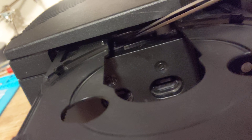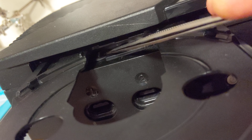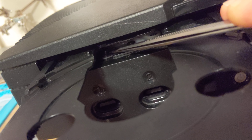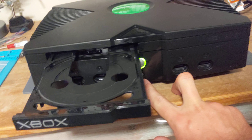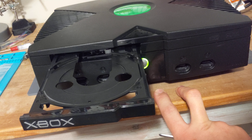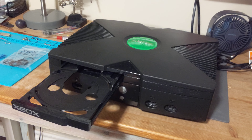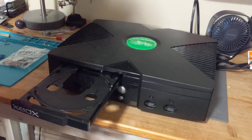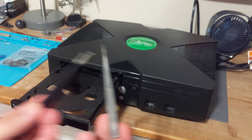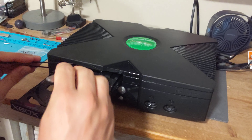I'm going to move the camera. Inside the tray there's a belt, but don't worry if you can't see it — you don't actually have to open up the console to get to it. You can use just a pair of tweezers. I'm going to keep this tray open, turn the console off, stabilize the camera, and then do my best to take out the old rubber belt. I find it best to use two pairs of tweezers, though you can do it with one.